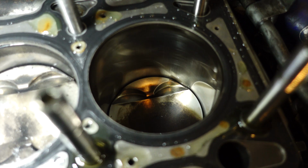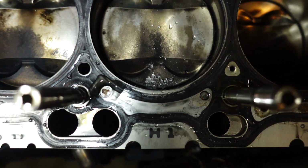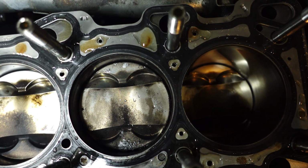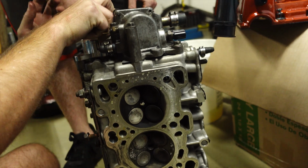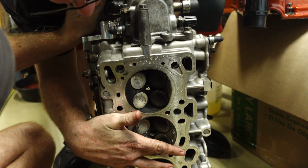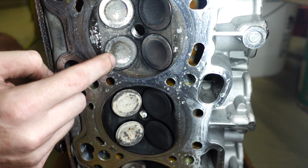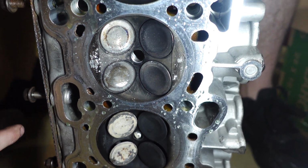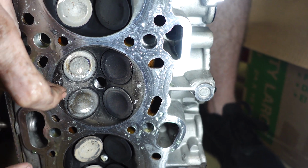Oh my god. Got a little damage to that. Yeah, just a little bit. Is it pitted? Oh yeah. That piston's coming out. Oh man, it's not that bad though. One of these is bad. 100% bent, guaranteed. So I just changed 2 valves, or 4 valves, if I want to reuse this head, and then I get this flattened out so I don't have any high spots.